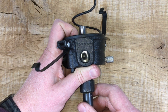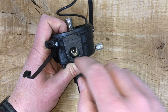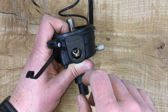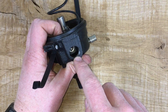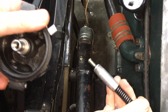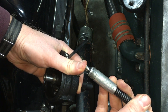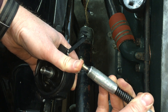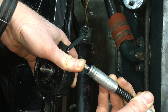The main way you can ground the lower plate is by threading in the ignition cable all the way. When that happens you push on this tab and can push it out of position. A lot of people want to screw this in all the way but you really do not need to. Here's the hardened ignition cable - you can see the end has a spring on it. As you thread this into the distributor body it contacts the tab, the spring compresses, and eventually the spring can't compress any farther and it'll just start to push the tab out of position.